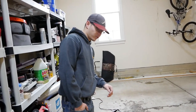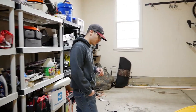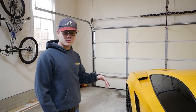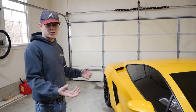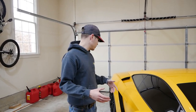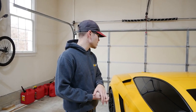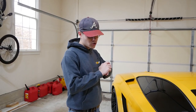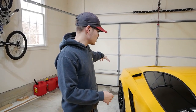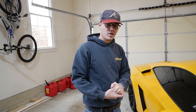Not really seeing many rock chips on the front, which is fantastic with 9,000 miles — but that's what we're putting the paint protection film on for. We already felt the paint and it feels pretty smooth. After the wash we're going to rinse the vehicle, apply Iron-X to remove any iron contamination as well as other fallout, then do a full mechanical decontamination stage just to make sure the paint is surgically clean.